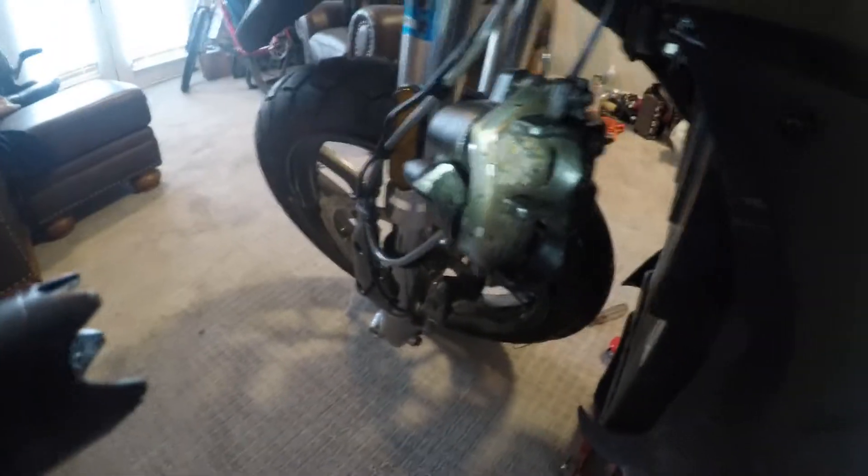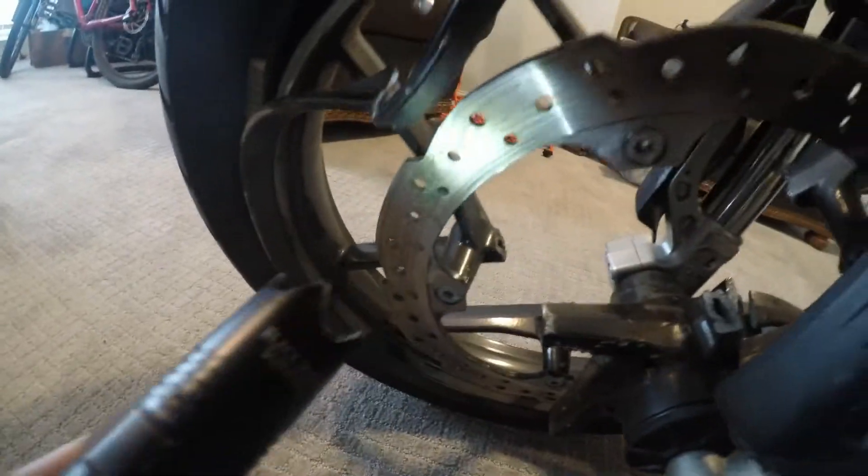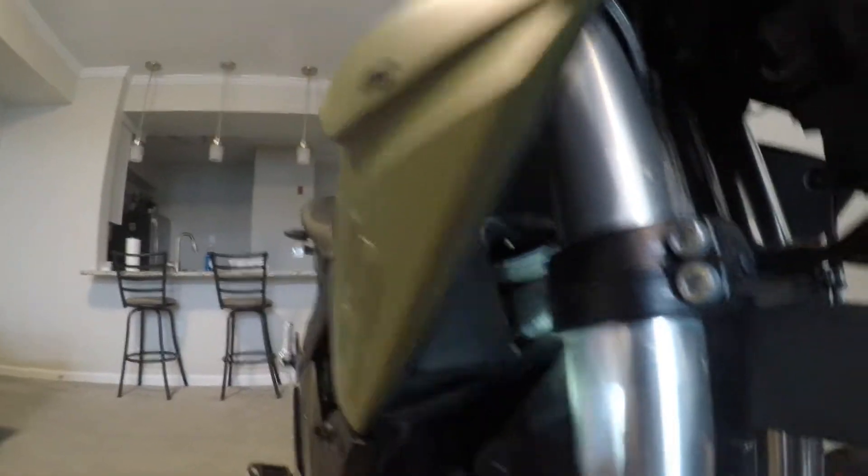Here are my forks - I'll turn this light down just a little bit so you can see. The Showa forks look to be in decent condition. It broke the brake mount here, and here is the brake further up - looks like it snapped right at where it mounts. So I may get lucky and be able to reuse this brake - it looks to be in really good condition. Brake pads also look good. The rotor is also bent, as you can probably assume with that kind of force. But the forks are straight.